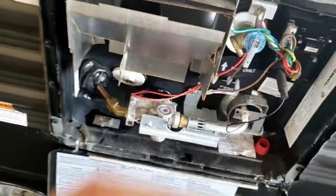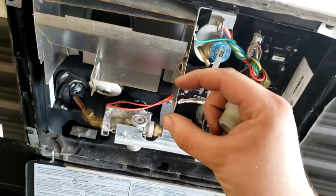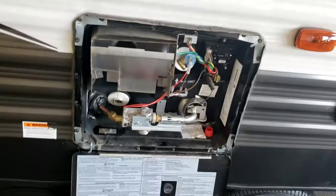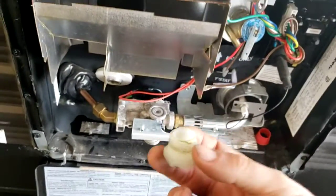The reason I leave them unplugged for people, I know we're kind of getting off the topic, is that sometimes there might be a little bit of water left in there, and if you don't use this trailer for a month after you buy it, that water is going to get stagnant. It's kind of a pain to flush out. So we try to leave them undone.